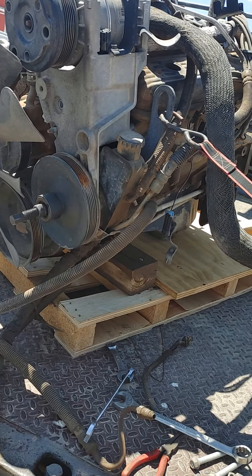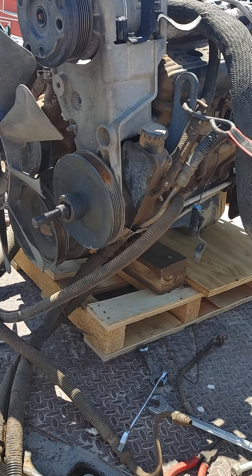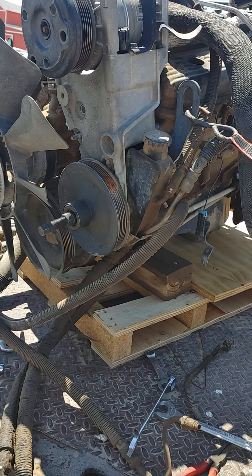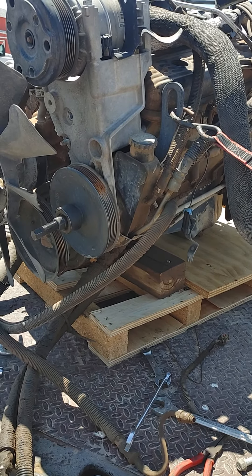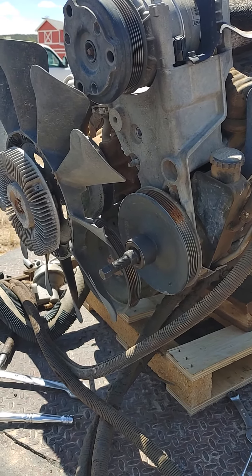The reason I'm doing this is because I'm going to pull these heads off, get them machined at the machine shop, and then pop them on an old school — I believe it's a 1979 or 1980 Suburban. We're going to throw the newer style Vortec heads on there just because they have a higher CFM to give it a little bit more power.